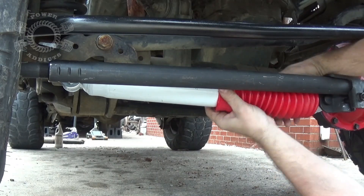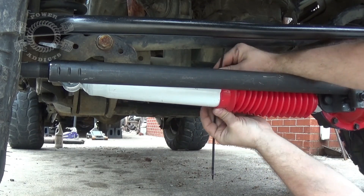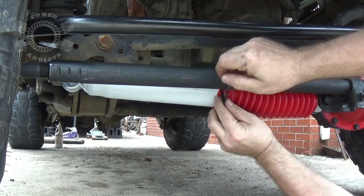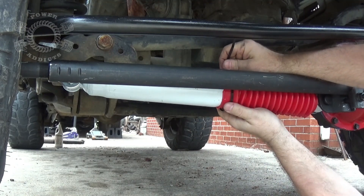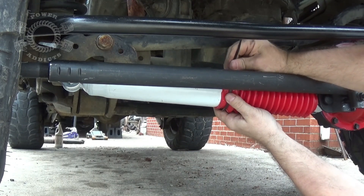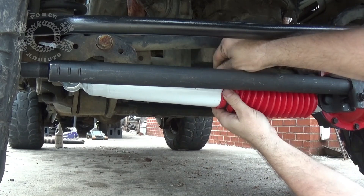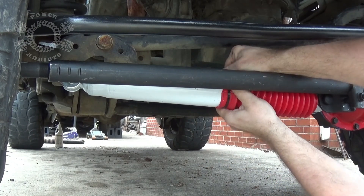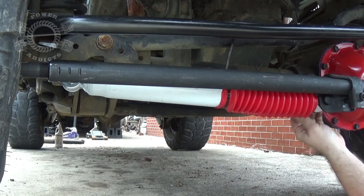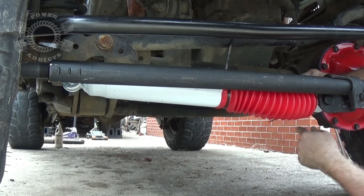While I'm under here, position that boot — it's got a gap. I always tend to push it toward the back because aesthetically I'd rather have it back there than up front, and the gap is right here in the back. Now I'm going to take my zip tie to lock it. Right here on the body it tapers up to a larger diameter, so I keep it back here — as the boot gets pushed back and forth turning, it doesn't push up onto a thicker part of the body and stays put. Cut that tail off in a minute.